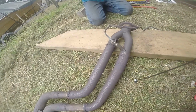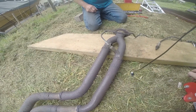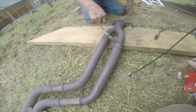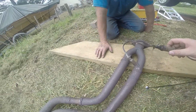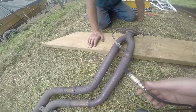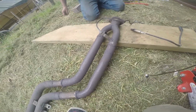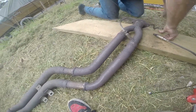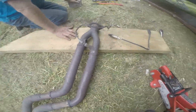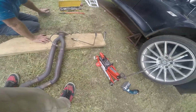Normally speaking, on the back, all these ones at the back are doing is really just putting a light on the dash effectively. It's just difference testing. Most systems will be looking at the front O2 sensors and using that to calibrate the fuel into the engine, and the back ones are just going around saying, yeah, the cat's working, or no, the cat's not working. And when the cat's not working, they throw up a check engine light. But they don't normally have heaters on, they're normally just a 2-wire cable.